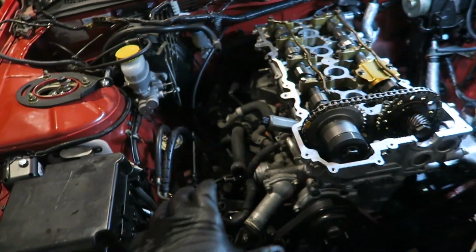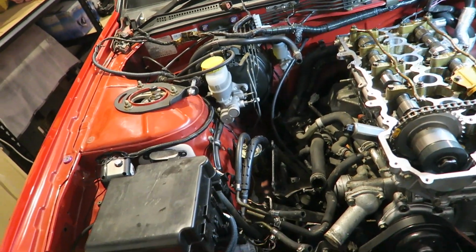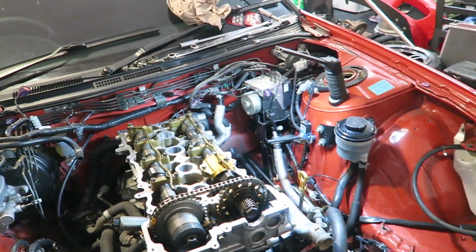You guys probably saw in the other video, but if you didn't, yeah, there it is. It's normally a bit more tucked than that, but obviously it's drooping because I've got nothing holding it at the front all the way through. They did my cold pipe as well, because I don't run a blow-off valve. I reckon they sound dumb. I know people say that they're bad for your turbo. I don't really care, to be completely honest. They did a nice 3-inch pipe that went through to my throttle body here. Had my intake air temperature sensor tucked up in there, so I was running no mass airflow.